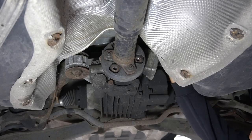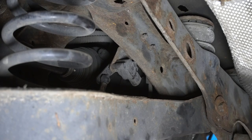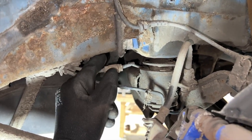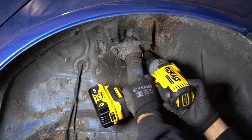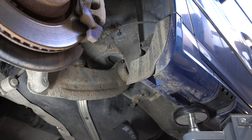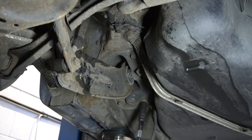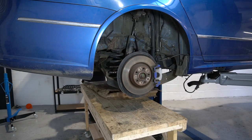In addition to all the bolts and screws, there are a number of wires to disconnect: the one going into the Haldex unit, the electric handbrake motors on either caliper, both brake pad level sensors, and the headlight level sensor on the subframe. Then it's time for the messy bit — the brake lines. I realised afterwards that you don't actually need to touch the driver's side, as the main hard pipe routes along the subframe itself; it's the two connections by the passenger-side brake caliper that need doing. One of them snapped at basically no force — another thing added to the list. Next were the shocks for both sides — two bolts each, and luckily on most of these VWs you don't have to go inside the car. Then the trailing arm, attached to the body with what looks like a 16mm bolt.